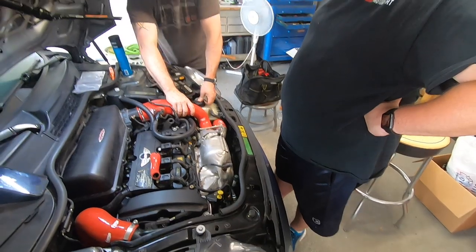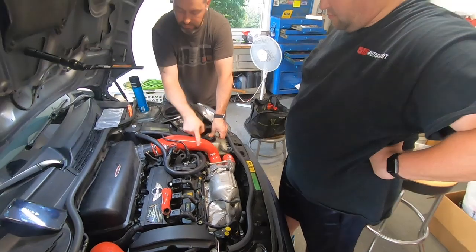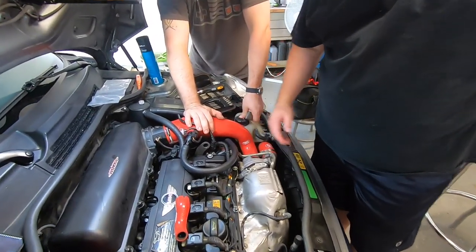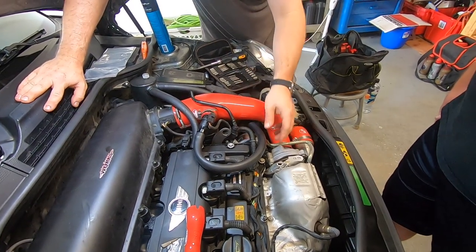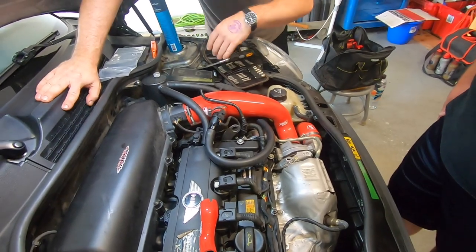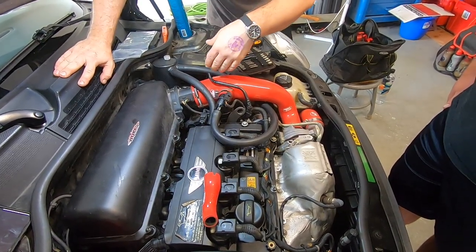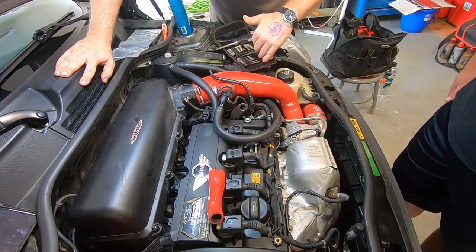If this were a factory hose, like what he was describing, basically what's going to happen is the inlet is right there and it's a straight shot to it — that's what we're missing. Basically, what we're trying to do is get the smoothest path possible in the PCV system. You want oil and air coming through, you want it to slow down, and then you want it to recirculate.